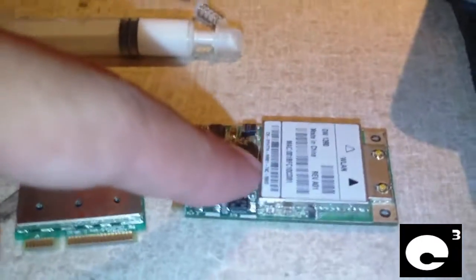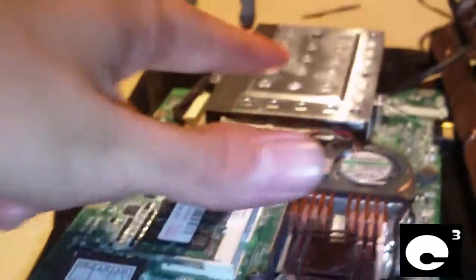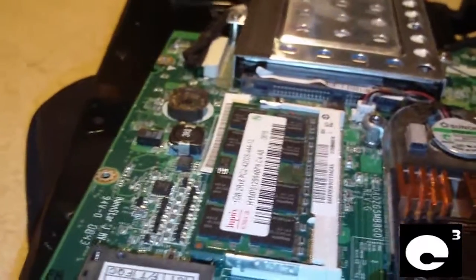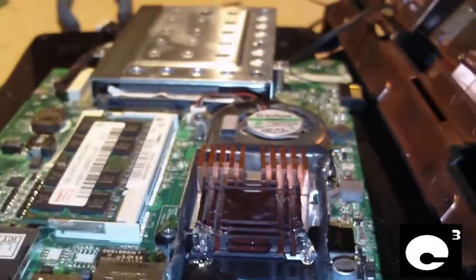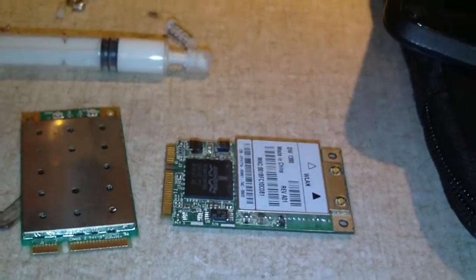Anyway, those are the big issues with these netbooks and how to fix them. The biggest issues would be the Wi-Fi adapters and the cooling systems. But if you want to upgrade, you can upgrade the memory or the hard drive fairly easily — at least in the newer models. The old-style ones like this, you've got to tear the computer completely apart to do that — to mess with RAM, hard drives, cooling system, that sort of stuff. You have to take the keyboard and the top piece off just to change the Wi-Fi card. There have been quite a few laptops I've worked with where you can just take the back panel off to get to the Wi-Fi card. Any questions or comments, let me know. Thank you.